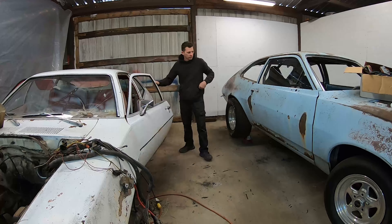I need to decide if I want to roll around in this mess and try to get the harness out, or just take the dash out. Put in the comments what you would do — you're going to get dirty either way. Why is everything sticky? I'm going to pick at the harness for a little bit and if I can't get it I'll pull the dash out. The problem is the fuse block is attached, so I need to get enough room to get the fuse block out from underneath the dash and bring all the stuff from under the hood with it.